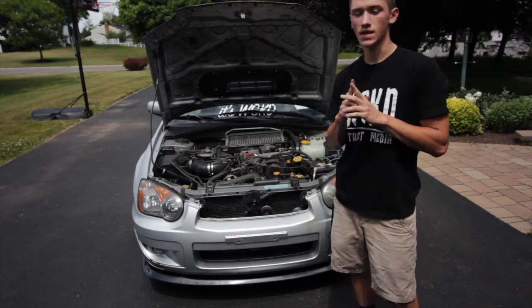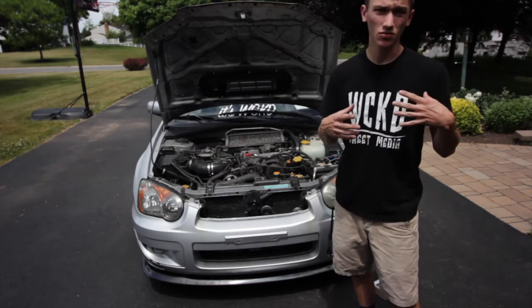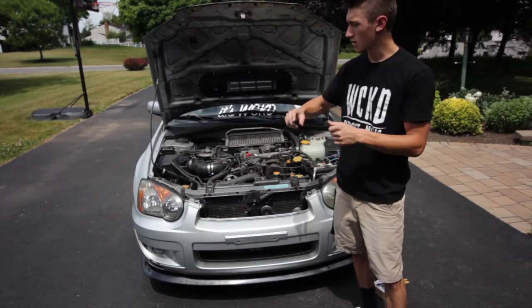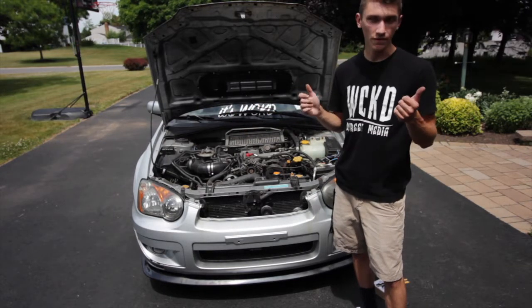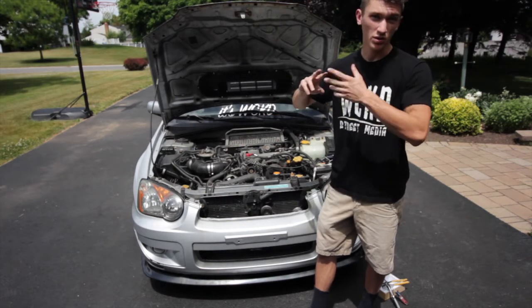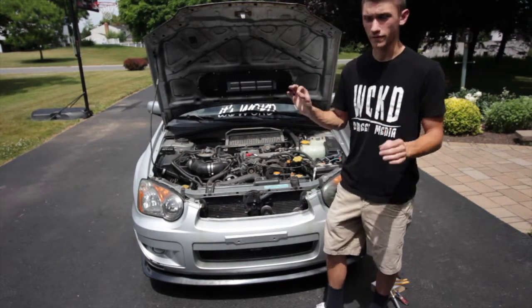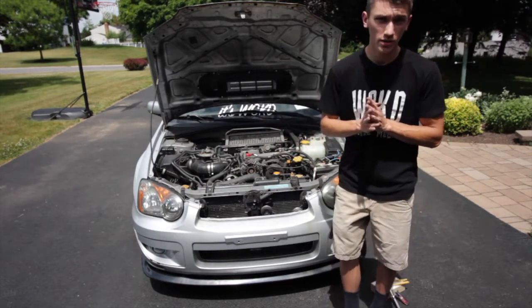One thing to note is that the positives and the negatives are reversed. So when I first turned it on, that actually didn't work. So I switched the positive and the negative from the actual bulb itself, and it worked fine. A little thing just to make sure that you remember to do, just connect those pretty much backwards, and then it'll work perfectly fine. I'll turn the key right now so you can see what both sides look like with the new LED bulbs.